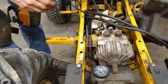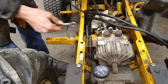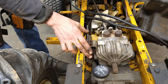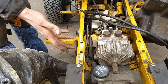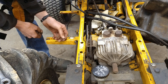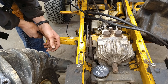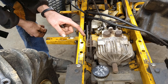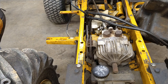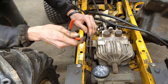I don't want that fuel tank to fall off. I'm trying to be very careful with the fuel tank grommets and stuff because I don't want them to develop leaks. These lines really should be replaced on this thing, but this repair gets pretty spendy once you price out these two plates — it's like $200 worth of plates. But it's good to grab them now; this is 2023, who knows how long these plates will continue to be available. A good pair of snap ring pliers is a must for this — if you've got a janky pair, you're going to be real mad because there's not a lot of room to work here at all.